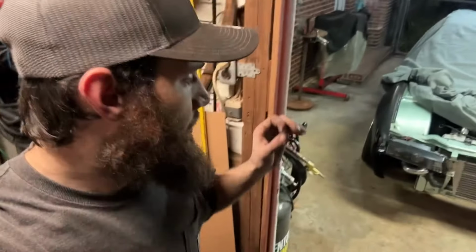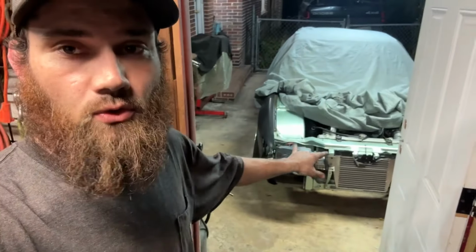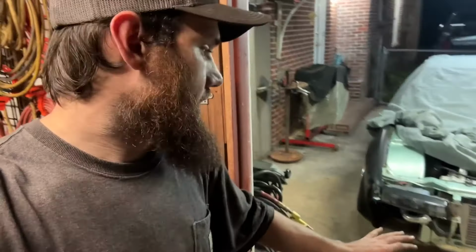That is a wrap for today's video, guys. I will be following up with part 3, and that'll be me burning in the actual elbows on the intercooler and welding the intercooler all out. I didn't want to dive right into welding the intercooler out just in case I needed to make any changes, or if the piping didn't fit behind the headlight brackets, or just something silly that I ran into, and then I would have to cut up my intercooler or cut sections out. So that's why it's all tacked up, and that's why it's the way that it is right now.